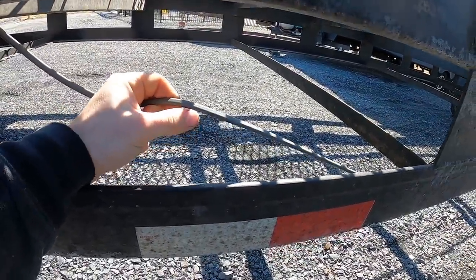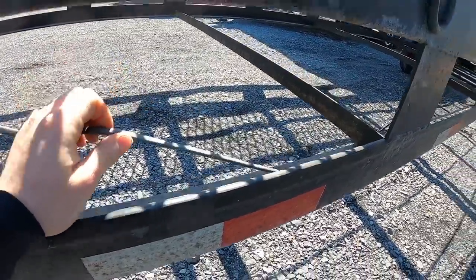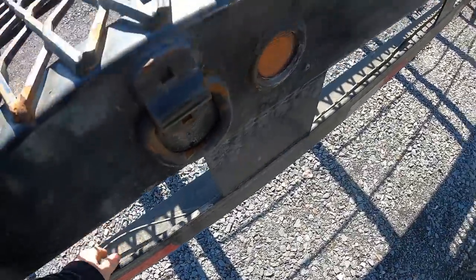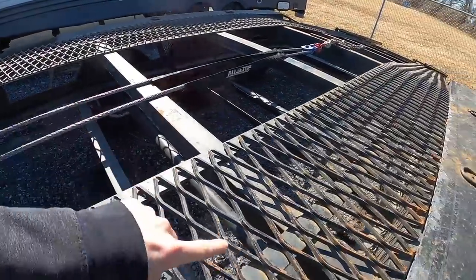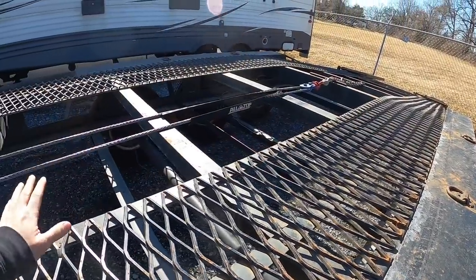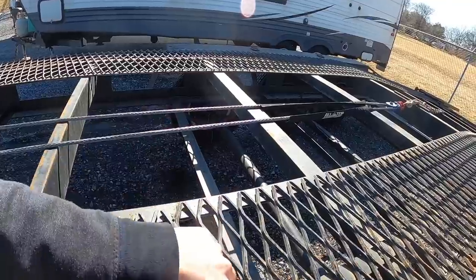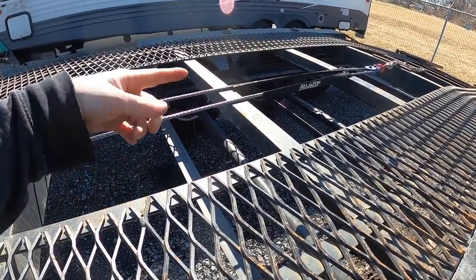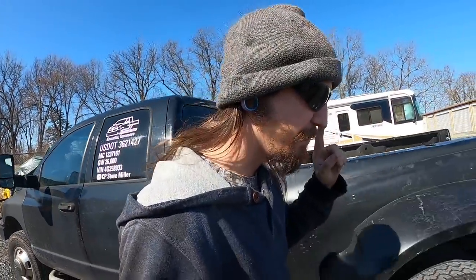You can see I ran this along the inside of the frame — that was just going to be temporary. I'm going to pull this whole thing out. I'm going to keep the factory brake wiring because it's actually in really good shape and has served me well with no failures. But any wires that go from each side of the brakes are getting replaced, and I'm going to run them on top of the frame rather than along the axle. That way if I ever need to replace axles I don't need to drill into anything.